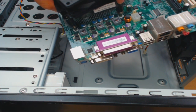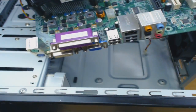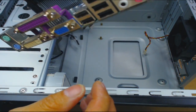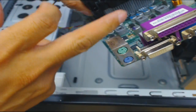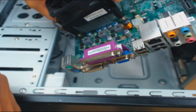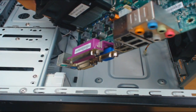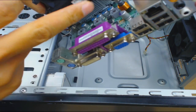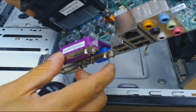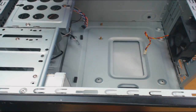You can hold it by the heatsink — the heatsink would be better, but this is a smaller heatsink. And that's it — that's how you pull it out. Notice nothing broke off, so that's why you want to be firm but not so aggressive that you just yank it out. This is a dead motherboard — I tested the CPU, took it out, put new thermal paste — it's most likely the motherboard. You can test with a multimeter, but CPUs very rarely fail.